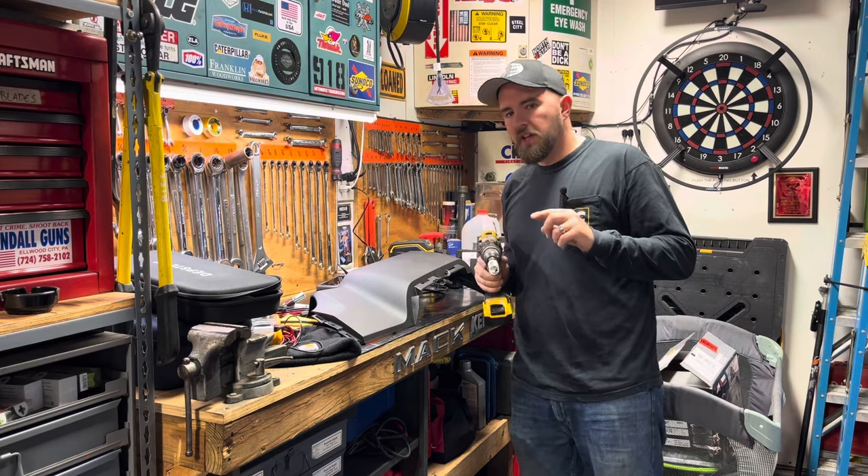Time for the final wiring show-and-tell before I put the kick panel on. I took a 90-degree female spade connector and connected it to one of the free male plugs on the bus bar, tucked the fuse holder in there with a 3-amp fuse, coiled all the extra wire in the kick panel, and ran everything else underneath nice and neat. We go up over the top of this bracket, zip-tied at the foot vent and on the wiring harness, and then up into the dash out to our outlet.